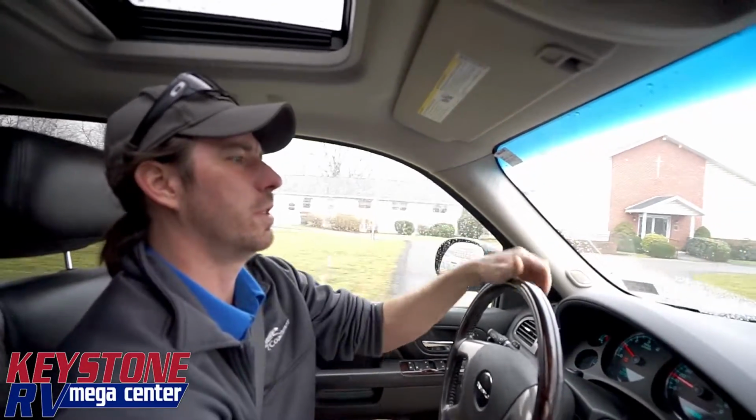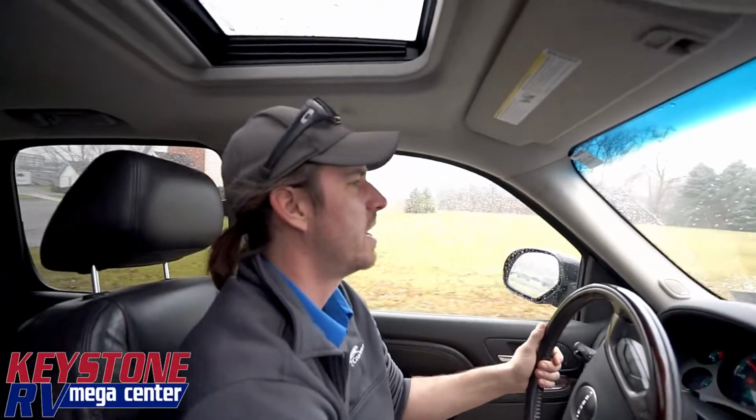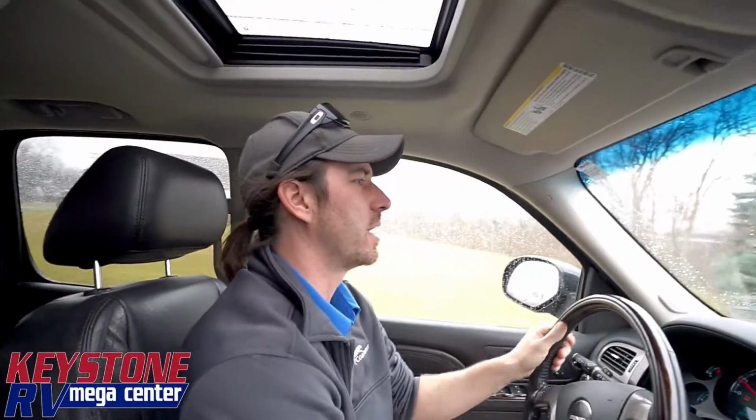And what I wanna feel, me personally, is I don't wanna feel the trailer pushing me, but I don't wanna feel it pulling me. So if you've never set up a brake controller before, my advice is going to be start at 7.5 and see how it feels from there. If you feel like the trailer's ripping you backwards, back it down a little bit. If you feel like it's pushing you forwards, go ahead and just bump it up a hair.